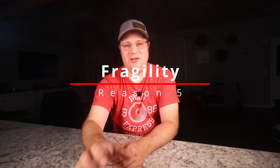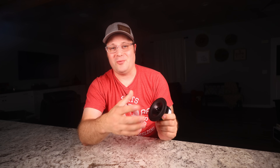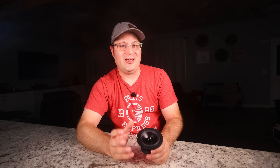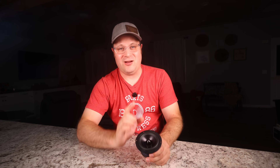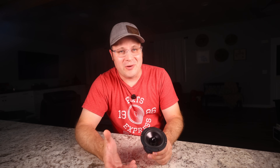Finally, let's talk about reason number five: fragility. Despite being rigid, aluminum cones are surprisingly susceptible to dents and deformation. A minor accident during installation or transport — like a dropped screwdriver or a slight bump — can permanently damage the cone. Unlike paper or poly cones that may flex and recover, aluminum cones will show every dent, and once deformed, their performance is compromised. Even visually, the dent reflects light in a way that's hard to ignore.